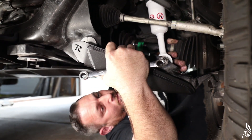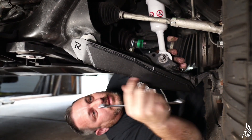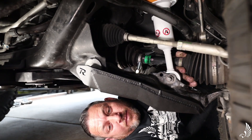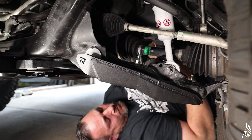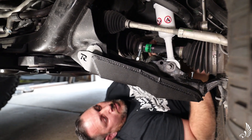The lower control arm skid is pretty much almost snugged up. What I want to do is just make sure it's even — make sure the bolt is even down here and it's not riding on the bolt in the front before I tighten it. Just a hint: if you don't have a ratcheting 14 millimeter wrench, I would suggest spending the 15 bucks on it because you'll be here all day.